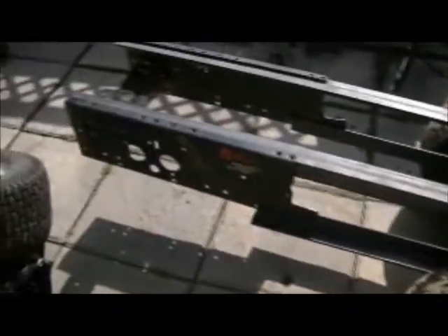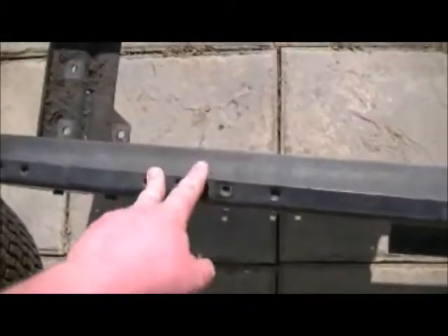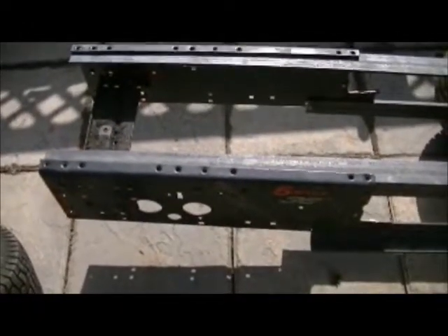On each side, it's hanging in about six and a half inches, which is pretty good. I want the strength of the original rear frame still, obviously with the new steel. I still got to clean up this — it has all the little threads underneath where you can attach the bolts through, so I got to clean all that off so this will sit flush. Then I'm going to use all those holes and just weld right through all those existing holes, just weld it in, and be done with it.